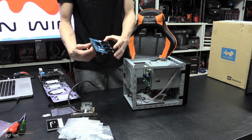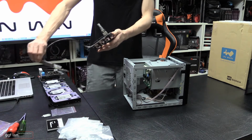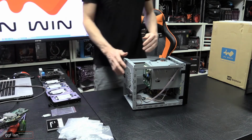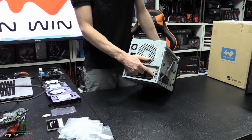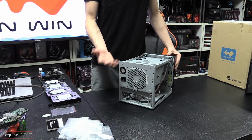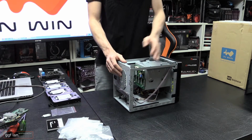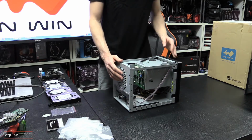So it's pretty sweet that you can get this option. Bear in mind, I'm pretty sure that when you buy the chassis, you're not going to get both. I think mine may have been an expo demo unit, and they've just had both in there. You can get that one off the website, which is pretty sweet, because it does have a half height PCI slot. So if you want to run a RAID card, most RAID cards have the option to go half height, or if you want to run this as a beefy home theater system, you could find a half height video card and throw that in as well. So that's pretty nifty as well.